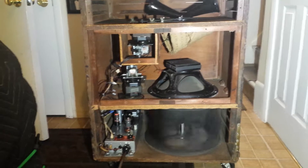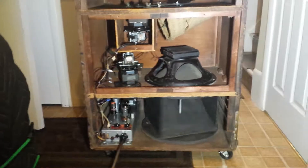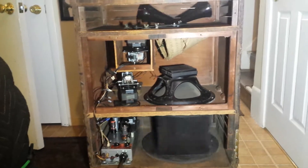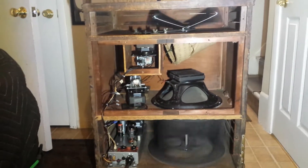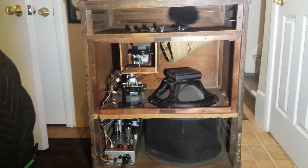I've got the pulley out. I've got the belt and the middle pulley on the top. The drum spin-down time is around five seconds. I adjusted the belt as the manual suggested. The horn spin-up time is about one and a half to two seconds. Spin down, same — about a second and a quarter to a second.